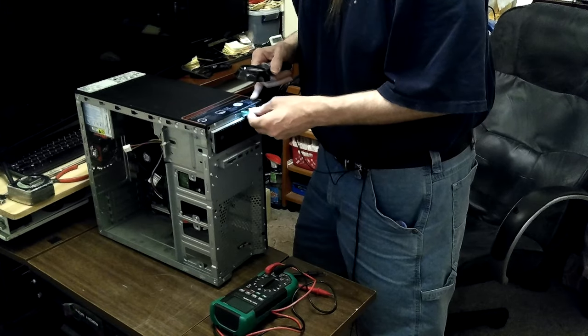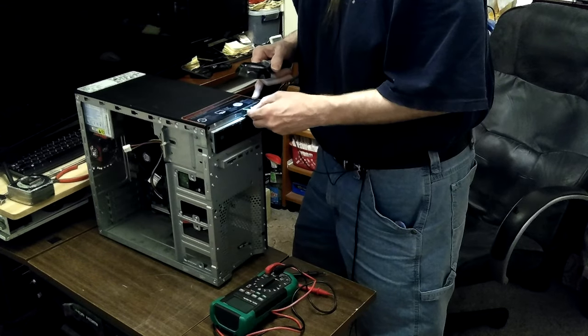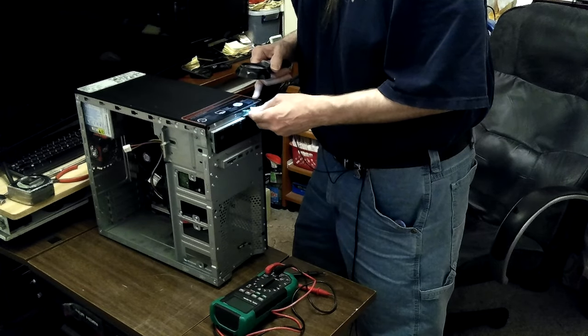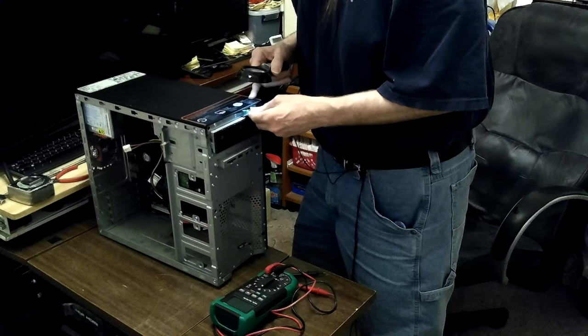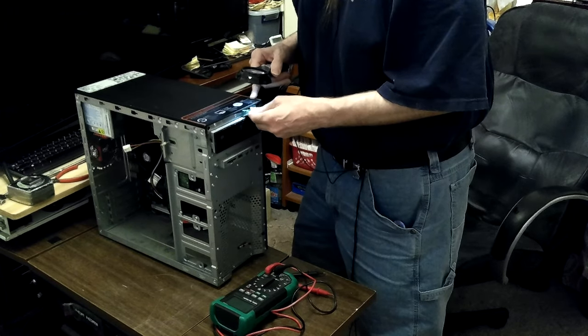Tried connecting it to ground with the test light. That should have made something happen if that was bypassing the switch. But really, yeah, power is on, looks like it's on the yellow one. But it's not hot. It is labeled on the front, power. And then I didn't know what was the other pin to finish the circuit, which I ended up just trying them all to try to jump it.